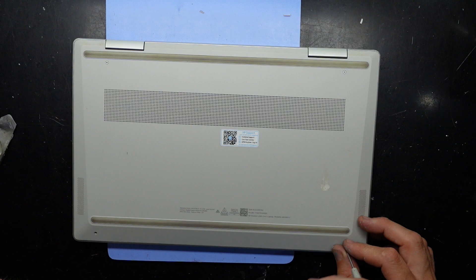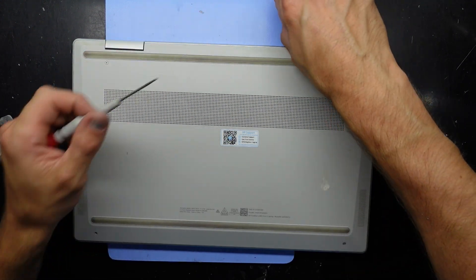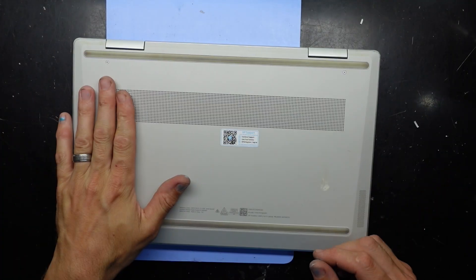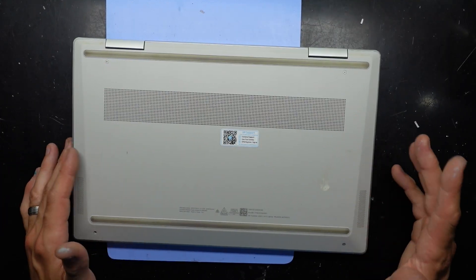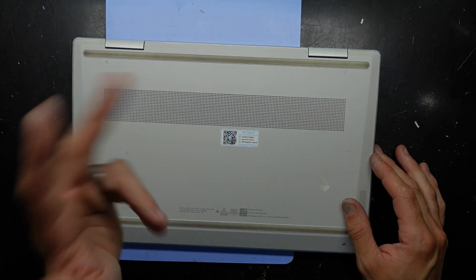So I did open it up to replace or inspect why this fan was failing. I did find that bit of plastic in there in the fan — highly possible it's that. But I also replaced the thermal paste on the processor, which did look to be okay, but while I'm there inspecting I might as well do it anyway. That'll do for today, and I'll see you later — bye!